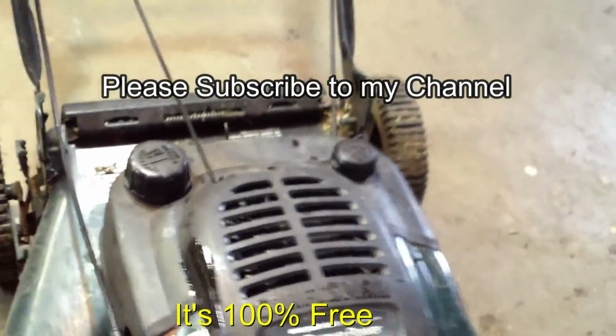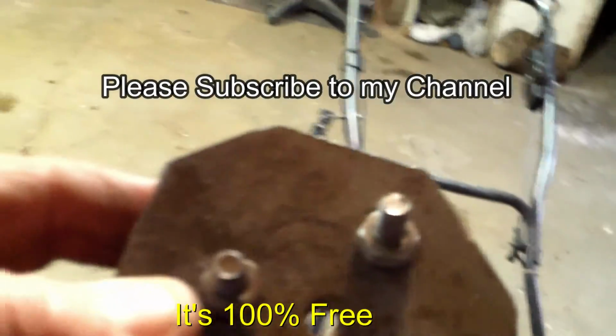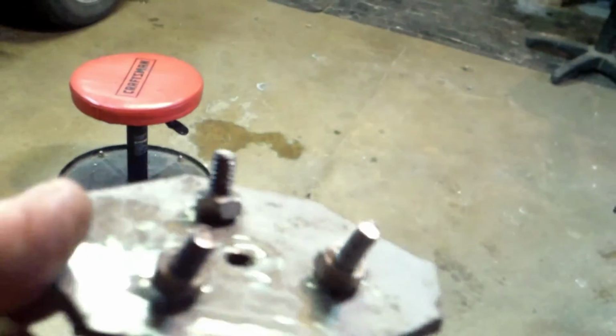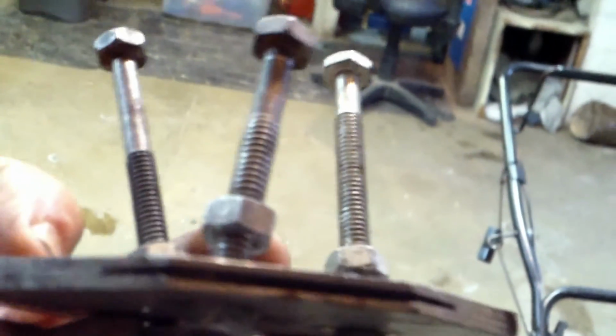The main thing you're going to need is some kind of a puller. Like I say, these 1/4 inch, just some long ones. They don't even match. They don't even have the same length. But they have to have different lengths because the ends of the crankshafts are different lengths. It's something so simple. It doesn't have to be that great of metal. Like I say, I made this out of a piece of an old chainsaw bar that was shot. Anything. I did have a hole in the middle there. Don't have to have it. It just happens it was there.